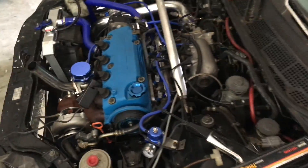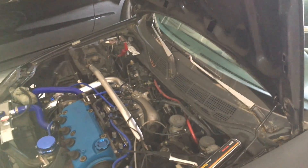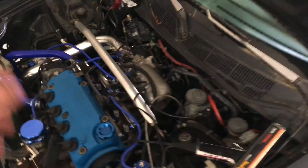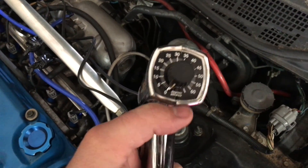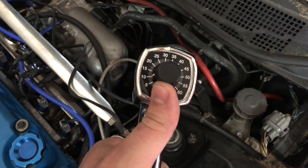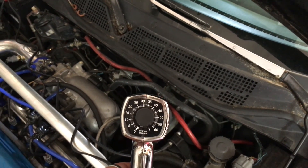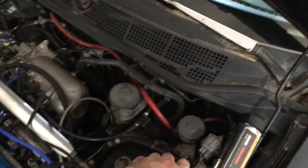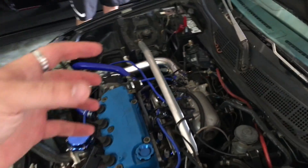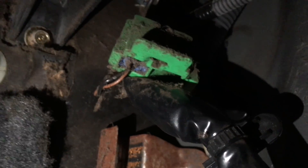First thing we're going to do — Chris has got us some wire. There's a service connector under the dash and you have to jump that out. That tells the computer not to control anything, to allow you to change timing manually. We're going to turn the ignition advance up to 16 degrees, because that's where the ignition tables start on our ECU. Whatever your ECU is set up for is what you want to put this at. There's the service plug, the ECU right up here — the green and blue connectors in there are what we have to jump.